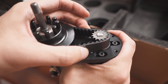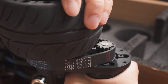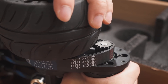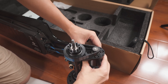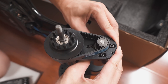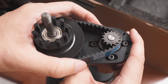So I'm trying to see how tight it should be. I've put on a wheel. This is what it looks like when the belt is too loose — way too loose. If you're holding onto the motor and trying to turn the wheel and the belt slips, then obviously that's too loose. What you want to do is tighten it to a point where the belt doesn't slip without being too tight. Move the motor out enough so that the straight part of the belt looks pretty straight, but not totally straight.